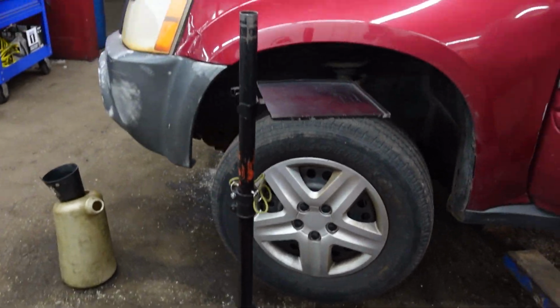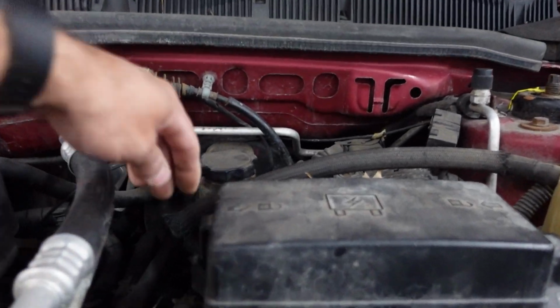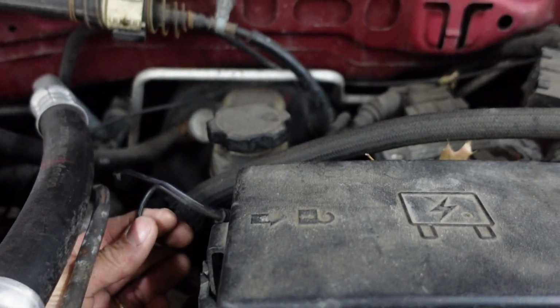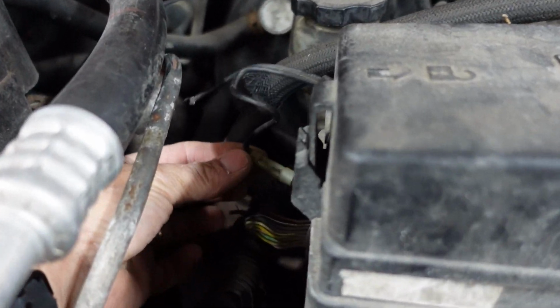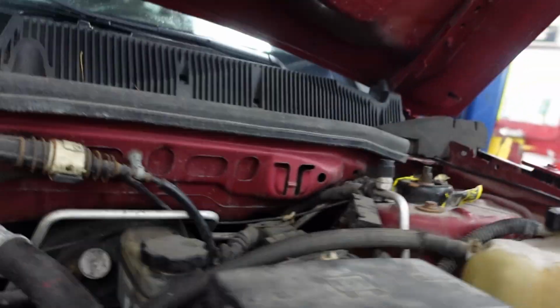And guys, I was just starting to set up my laptop stand to fire up my laptop computer, and I forgot about that wire down here. This thing, I don't know what's going on here, but I think this is probably going to be the problem. Look at this. This is going to a speaker cable. I bet you that they interrupted the starter system here. So, I mean, this is almost for sure got to go there, right? I'm going to jump it and see what happens.